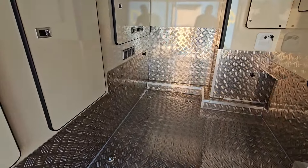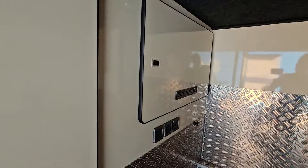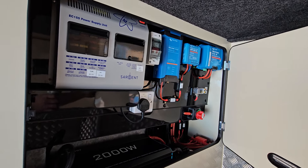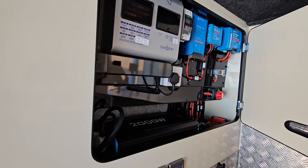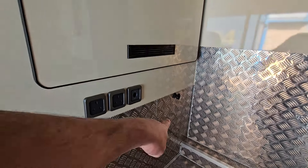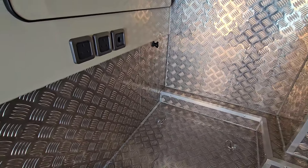We've got a bit more storage under here. We've got the boiler located in the back to give maximum storage in the front. We have put all the electrics behind this cupboard here — so we've got your EC155, all your Victron gear for your solar panel, DC-DC, 2000 watt inverter. We've got your 230 amp lithium battery under there.